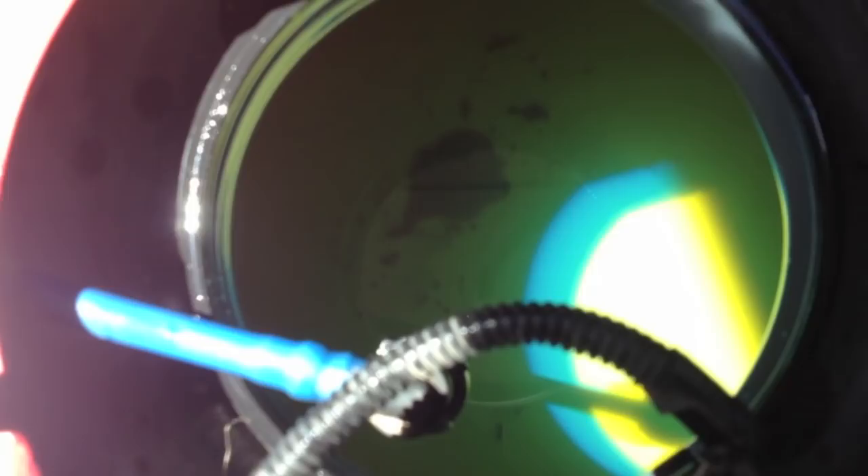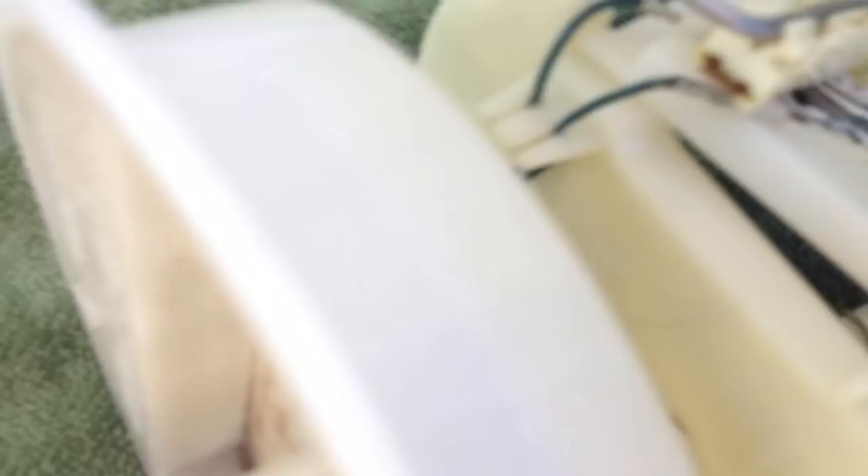Here's the original fuel sender from the vehicle. You can see there's some gunk on the outside and some crap on the inside — it probably could survive with just a wipe down. But I'm going to go ahead and replace it since it's a $30 part. If you look at these tiny little traces, each of those help with the fuel level gauge, with different resistances for different traces. There's some crap on that — I bet just wiping it down would probably fix the fuel gauge. But since you're in here, I'm just going to replace it all.